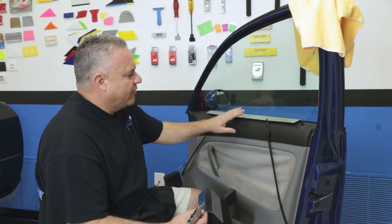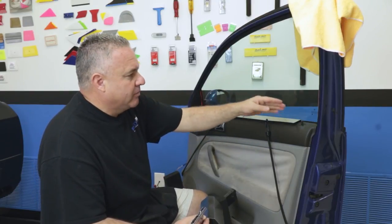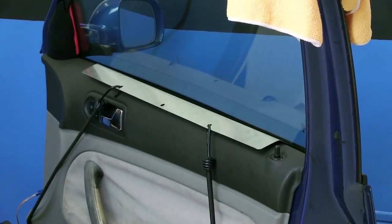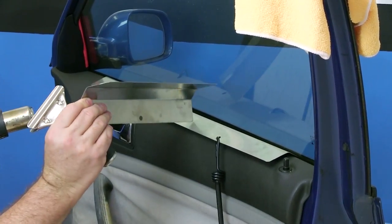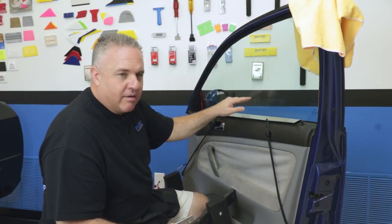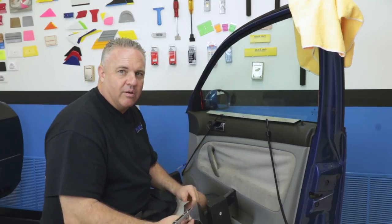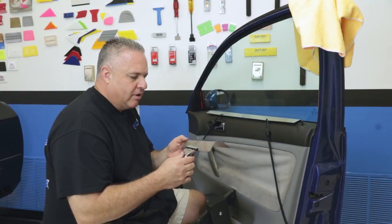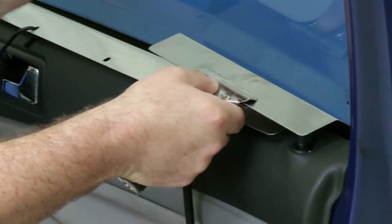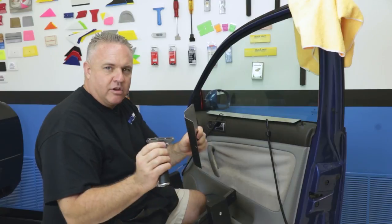I want to point out a few things. If you put the film on and you've got some small finger bubbles at the bottom of the glass, this is also a great heat shield. You can take a heat gun, heat the fingers out, and almost eliminate the chances of burning a door panel. If you didn't have a heat shield and you're heating a finger and the heat bounced off the glass onto thin door panels, that's where you burn the little holes. That's where customers get real unhappy. People are also modifying handles and using them here to work the film along the way.